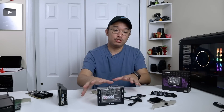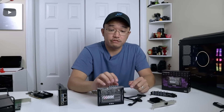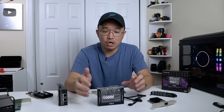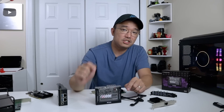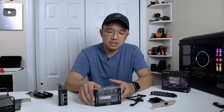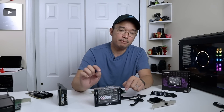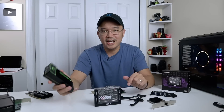A couple of projects that come to mind: one is using it as a NAS setup, and another is a Plex server. It'll do wonders for Plex because the GPU supports H.264 and H.265 decoding. You can add hard drives directly or add a graphics card via the PCIe expansion port. I'd also use this as a retro arcade — it should support up to PlayStation 2 easily, since I was already able to run PS2 games on the slightly slower Zima Board.